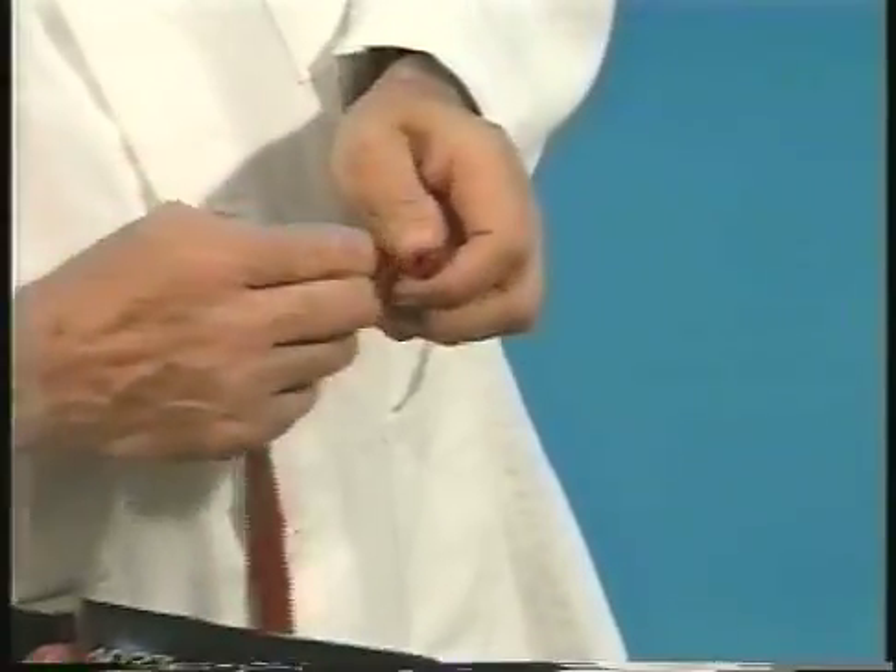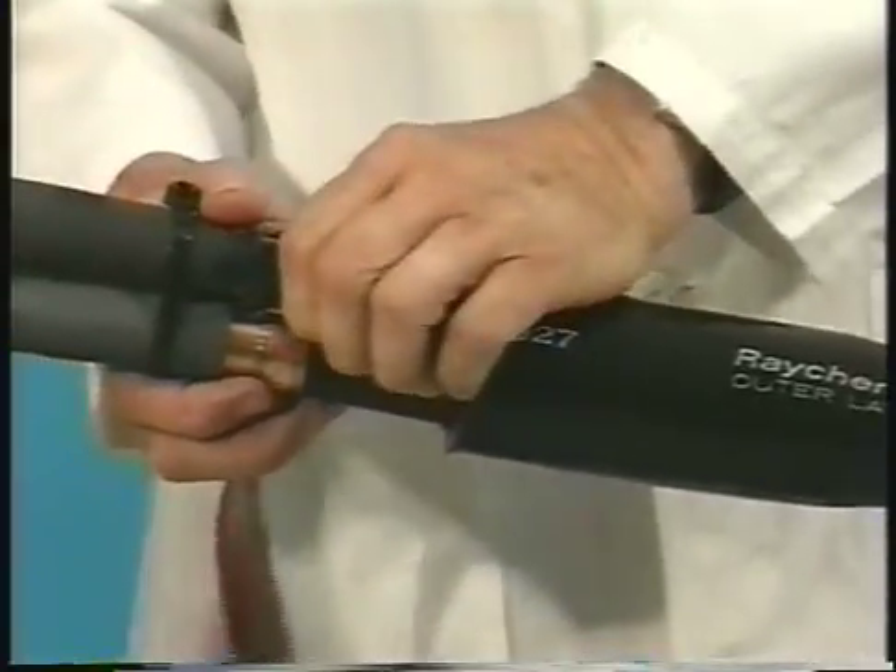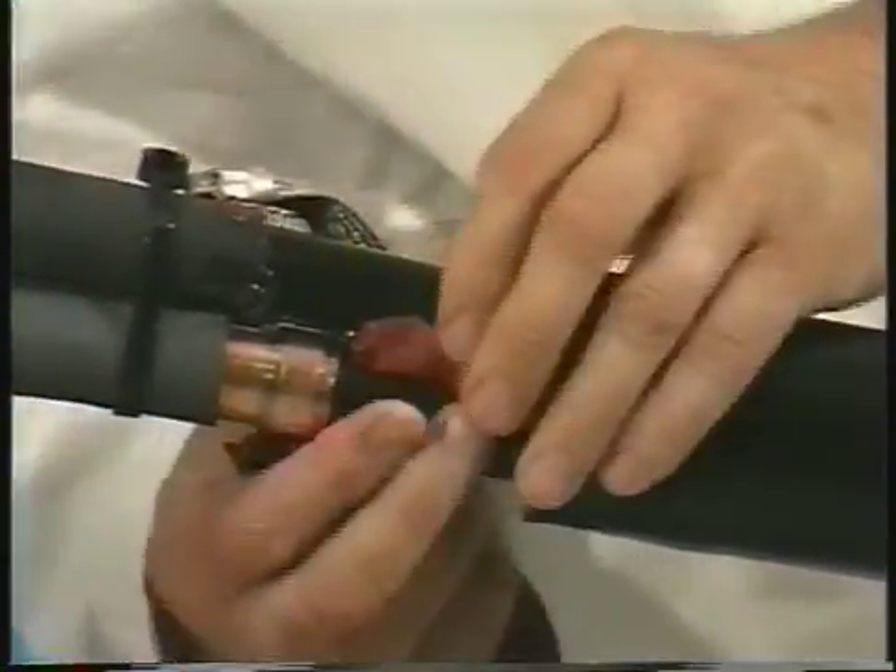To fill in the gaps between the two cables on the tap side, remove both backing strips from a length of red sealant and roll it up into short pieces. Fill in the gaps by pushing the sealant into all of the open spaces.